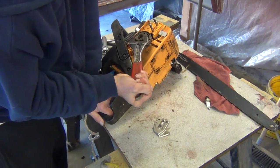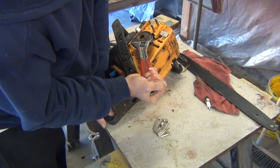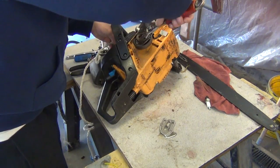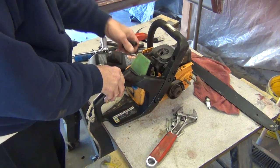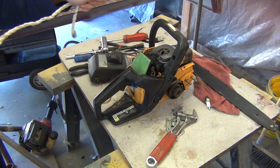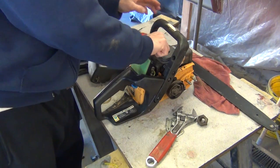I wouldn't really crank it. I guess you could tear something up if you got too forceful with it. Remember, you are pushing that piston up against there. Okay. Now we just pull the rope out. Everything sounds okay. Make sure. I heard a little bit of a crunch. It was my actual nylon rope, though. Kind of worried me. But I think that's a good way to tighten it up without tearing too much up. Always remember to take that off. Push the plug back in.